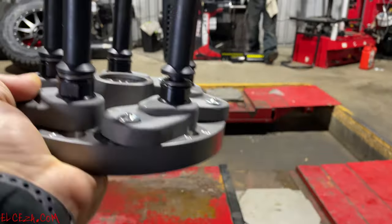How would it know if the wheel slipped? What do you think? It sees that rim, it knows how fast the spindle is spinning, and it sees how fast that rim is spinning, and if the speed doesn't match, it's, hang on, something ain't right. Okay? Because it's counting those spokes as they go by in order to give it that profile picture.